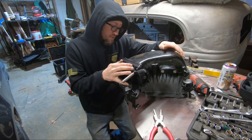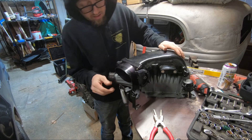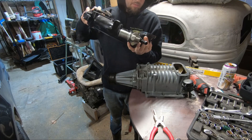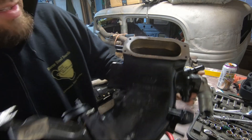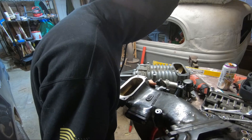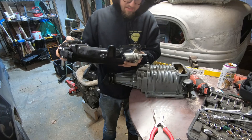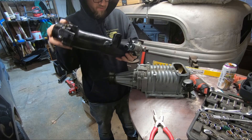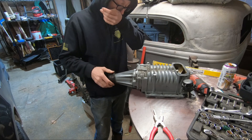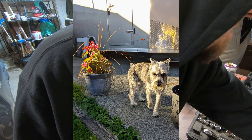Didn't really take me too long to get this off. We're gonna pull this upper plenum off — it's already been ported so we don't need to worry about that today. We're basically gonna go down and port up the main manifold. You can see that port that's been done on it — it looks like it has a very homemade gasket, which is pretty crappy. The blower turns super nice though.